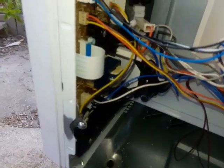Oh, by the way, before, I noticed that I think that's a problem because before I could open this door without pushing this button. Now you see I can't do it. I tried to yank it out and I can't. I have to push the button, and you see how that thing just popped right out. And when I close it, now I try to open it and I can't. So I think that's a problem right there. But let me turn this oven on the right side and test this. Okay, I found a problem with this microwave.